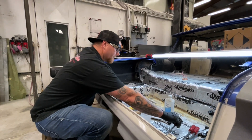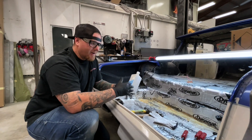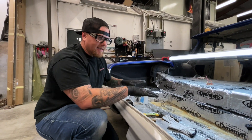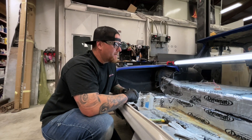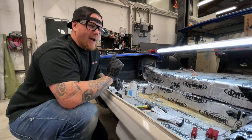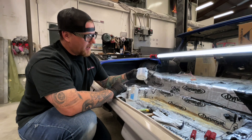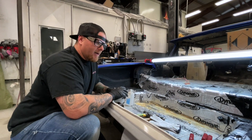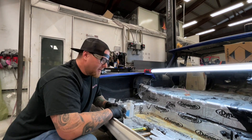You're going to need some chisels and a hammer to smack it around and get it chipped off the floor. We're going to aim to do one brick at a time to start. Chip it up with the sledgehammer to about a melted snow consistency so it lays down over the Dynamat nice and flat. If it's real chunky, it's not biting into a flat surface. If your car has Dynamat in the roof, you might need to put it on a rotisserie and flip it upside down — that's what we've had to do. Work with a small cup to scoop it from the ice chest and dump it in. Pat the snow down with the dry ice and let it sit for 30 seconds or so until it freezes.